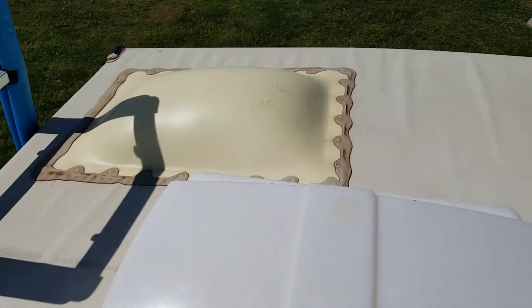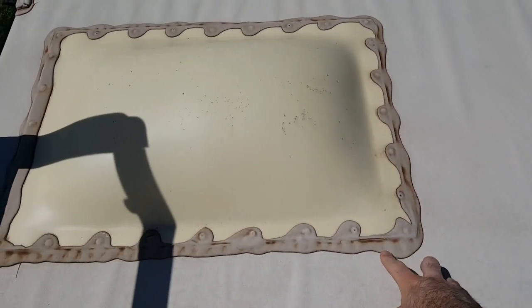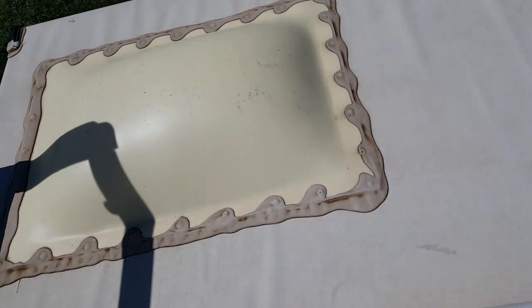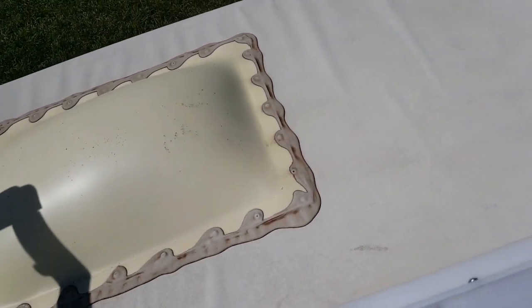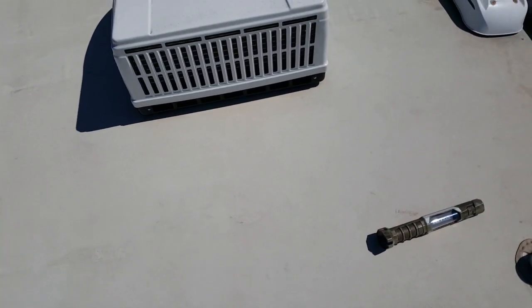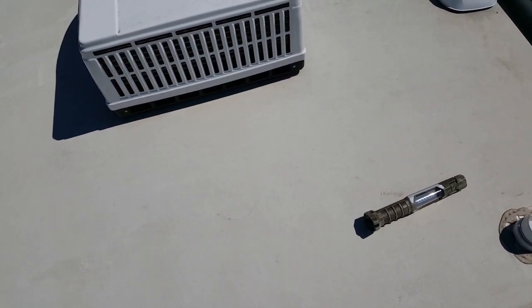And then you have your skylights. And so you're going to just be checking this old sealant, as I'd said on the old stuff, for cracks, separation, lapses. You can go ahead and just inspect your roof in general to ensure that while you're towing, you didn't hit any tree branches, maybe you tore a hole in your roof. When you're up here, take off your shoes, as I've done, and just wear socks. So that way, it's just more gentle on your roof.